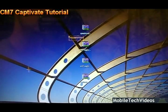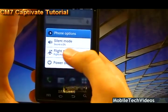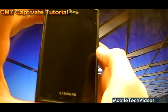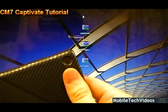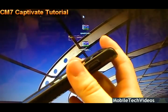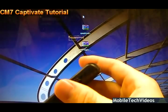As we just talked about, you need that three-button fix. Be sure to check out the three-button fix video if you need to learn how to get that onto your phone. Once you've gotten that done, go ahead and power the device off. We're going to get ready to flash a kernel with support for ClockworkMod recovery. Power the phone down and we'll proceed once it's off. Once the phone's powered off, we need to put it into download mode.